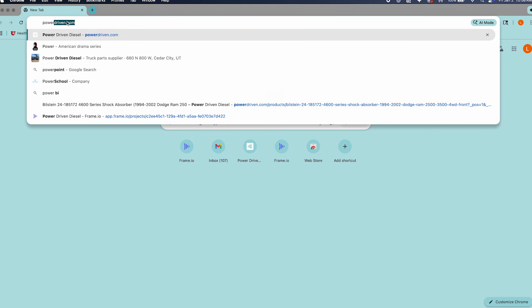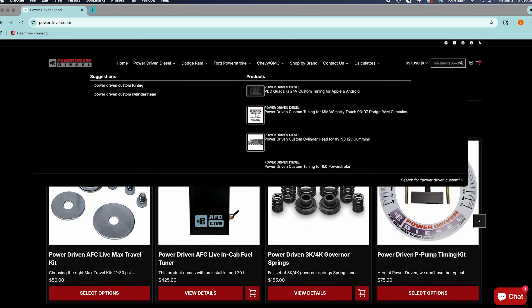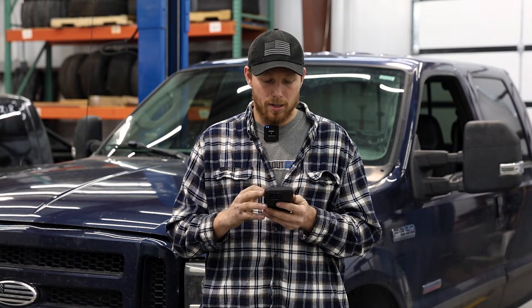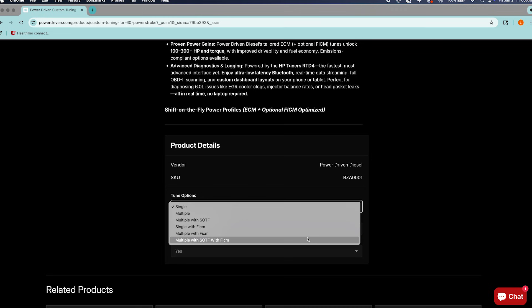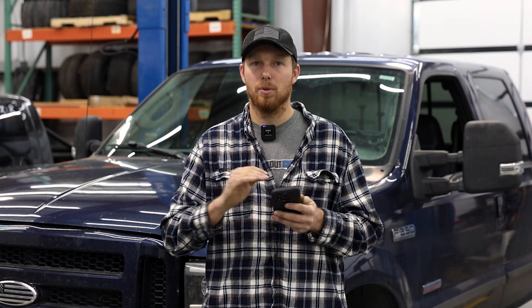The first thing we're going to do is head over to powerdriven.com and search 'Power Driven custom tuning for 6.0 Power Stroke' — the link is also in the description. This is custom tuning so we need to know what your truck has. First option is tune option: single versus multiple. A single tune gives you one tune file; multiple gives you multiple tune files, but you have to reflash every time you want a change. That's where 'multiple with shift on the fly' (SOTF) comes in — you can use your cruise control buttons to make tune changes on the fly while driving down the road. If you can swing it, 100% recommend that.